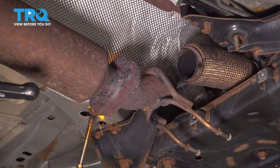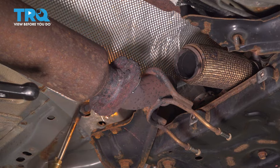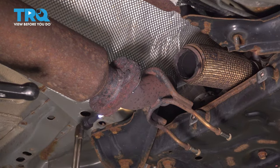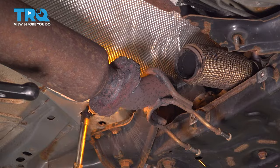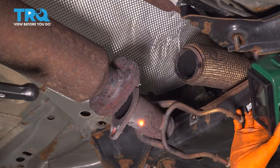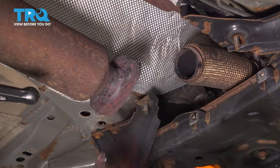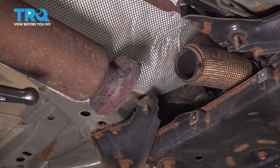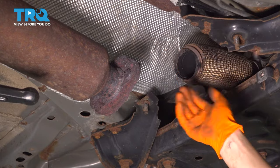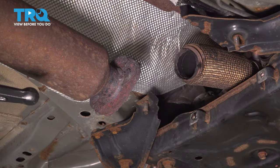You probably can't see this side, but I'm gonna cut this side. Now, with the mounting hardware torched off of there, take this off and discard that. And there are still studs in here. I'm gonna have to basically cut them flush, drill them out, punch them out, or just melt them like I did the other side so that I can put new mounting bolts in here.